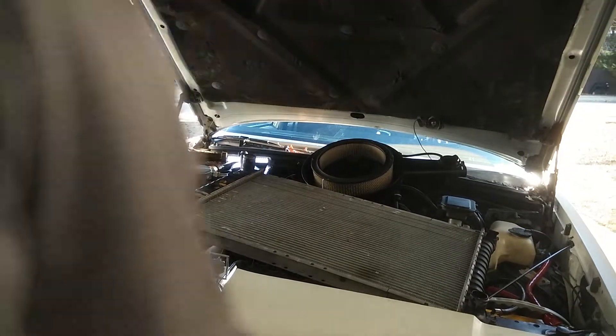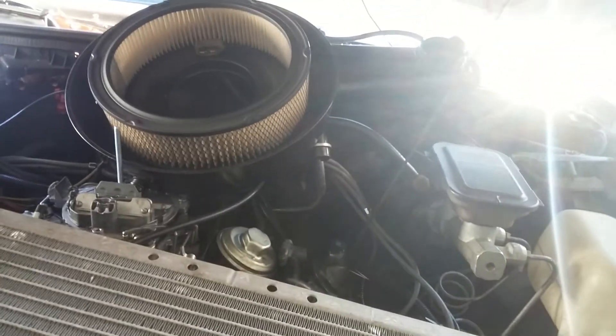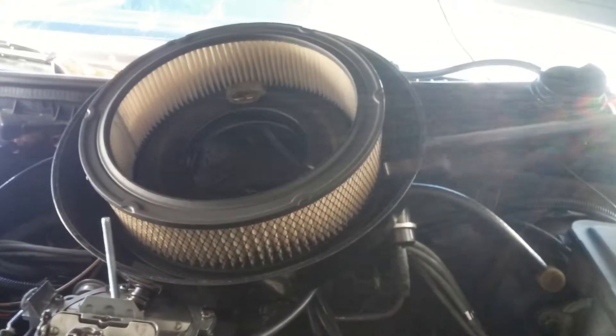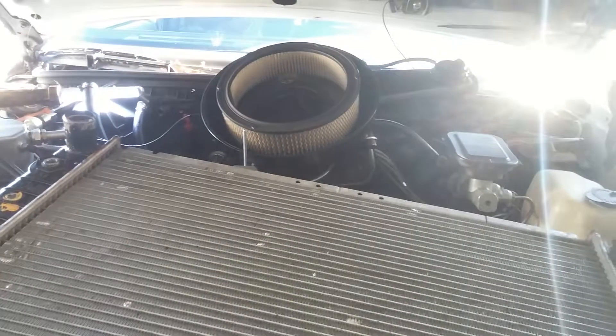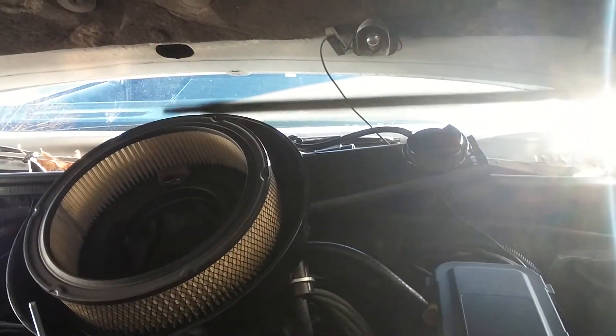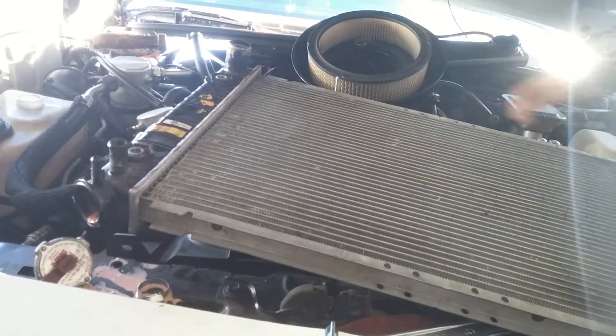So basically, I came over and checked my dipstick, because normally when you see a milky substance in the oil, it's normally a light brown, milky-looking color. But this one is not. Normally when your head gasket is bad or your block has had oil running through a crack, it's kind of milky colored. This is not — this is just a regular color of oil. So that lets me know that my oil and water are not mixing, which is a good thing.